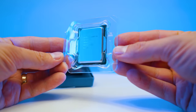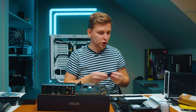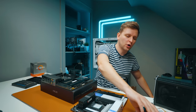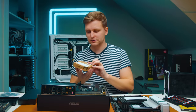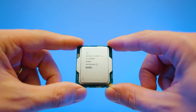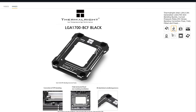We've got the CPU — the 13900K. I'm not going to close the socket just yet because we're going to do something extra. You might have heard of contact frames for 12th and 13th gen. There are ones from Thermal Grizzly but they cost about four times as much as something from Thermal Right, which I have here for less than £10. Because of the 13900K I want to get as much performance as possible — a lot of heat goes into the CPU and I don't want it to bend.